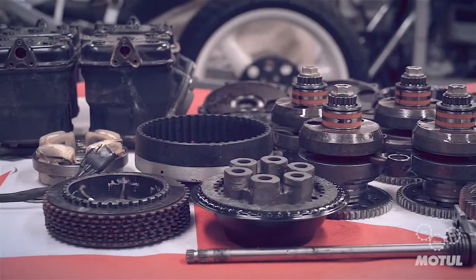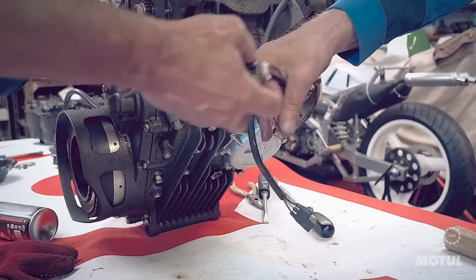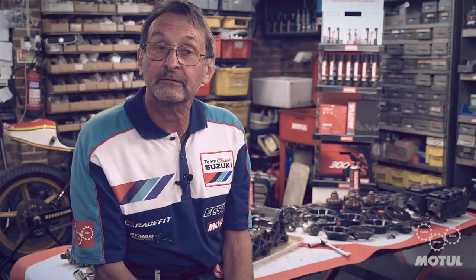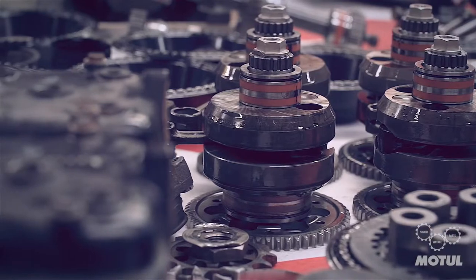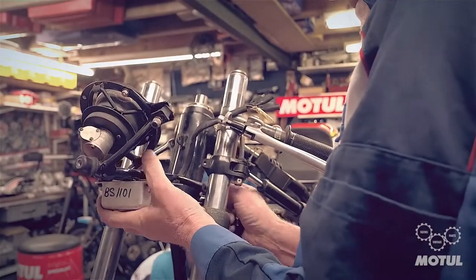Overall, looking at the various components — the rotary valves, the ignition system, the water pump — they are perfectly serviceable. The interesting point on the engine is it used to have an oil pump, which is still blanked off with an aluminium plate. But other than that, for a machine that's 42 years old, it's in remarkably good condition engine-wise. Chassis-wise, that's quite easy to fix, and we'll run through that later on.